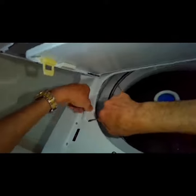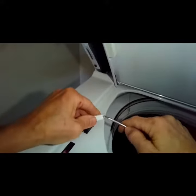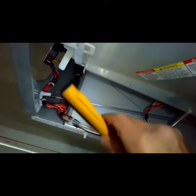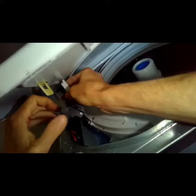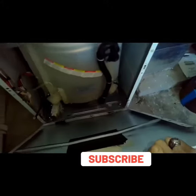We're going to push in there a screwdriver to get this lid sensor out. We pushed in on that little tab to get it out, then push it back in. These orange wires are probably where the break occurred, so we have to splice in the new sensor to those wires.